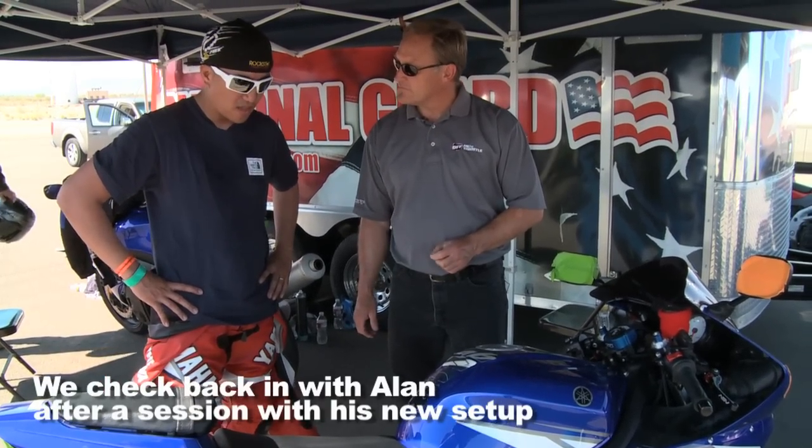The chassis is unbelievable — it's a lot better from earlier this morning. So you can really understand the value not only of just the basic setup to your weight and balancing the chassis out, but the value also of comfort. There's a flip side to all that adjustability too — if somebody wants to have a go at it and try it, they could get completely lost. Your techniques of getting the rider correct first have an invaluable effect on the suspension itself, because of the better riding technique.